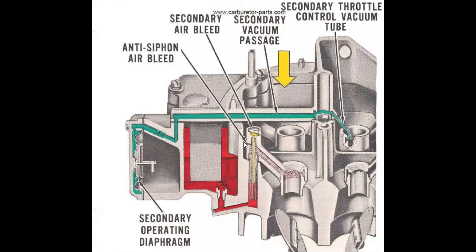This one on the side is anti-siphon, and incidentally, if you see gas dripping out of your secondary when it's not supposed to be, then chances are this little orifice here is plugged — they're very small. The air mixes with your fuel here on the secondary side, and then the air-fuel mixture comes down into your venturi and comes out of this small hole here in your venturi, and feeds your intake. That's how it all works. Hopefully that will give you an idea in case you have a problem. Thank you for watching.